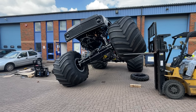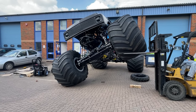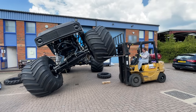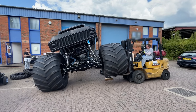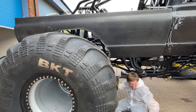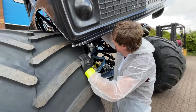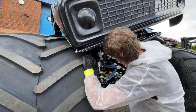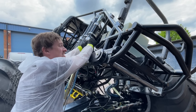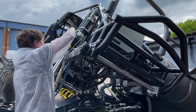It's just moved on that tyre. The idea of flexing this — we can see what the full travel is. We're going to try and let the shocks down. We put some more pressure in the shocks and that's going to give this side maximum travel, the other side maximum down, and then we can cut our arches out — or the fenders.